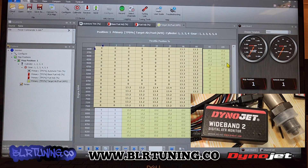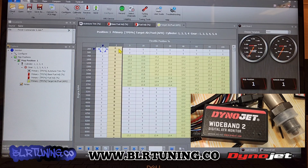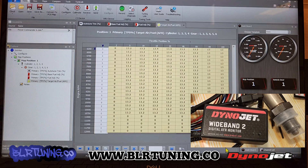If your bike doesn't have an O2 sensor, then Power Commander can control 100% of the fuel map. So if your bike didn't have an O2 sensor, you would have AFR numbers all the way out here through this whole thing, and then your auto-tune will work for the entire fuel map.